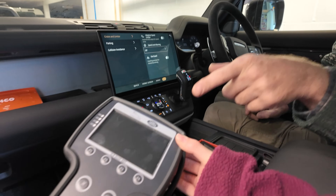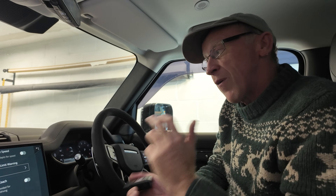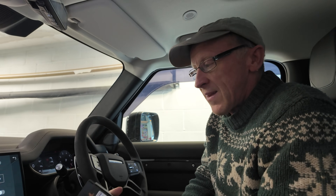The first thing we're going to do is plug the IID tool in, because it lets us see all the individual CCF settings for adaptive cruise control — so we can see the before and after. Then we're actually going to use the Diagnostics Associates tool to make the change, because it's a one-click process that does everything for you. The Gap IID tool, once you've bought it, lets you change CCFs on your car as much as you like and read fault codes for free — it's a one-time purchase.